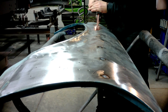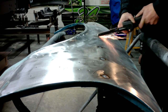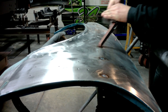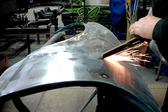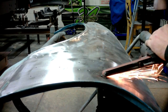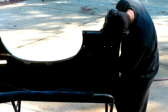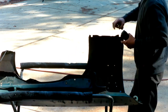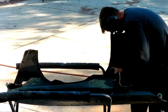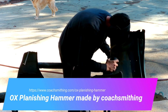You can see there are some other holes in this fender — they will stay there for these little side vents, and then there's 350 emblems and also the Nova badging, so we are going to leave all that. Again, we're just covering up the trim molding front to rear that went down the side of the door and on the quarters. Since we replaced the door skins and quarters, we didn't have to weld up the holes on those panels. Now that we have the trim holes welded up, we'll go ahead and address the rest of the bodywork needed on this fender.